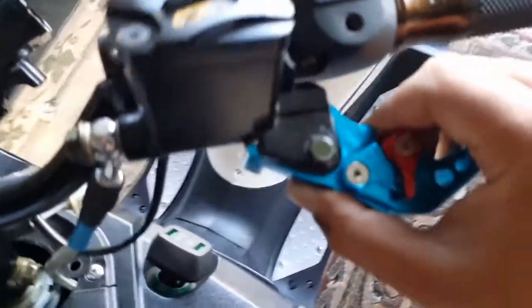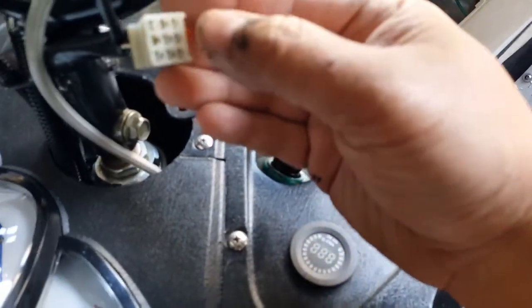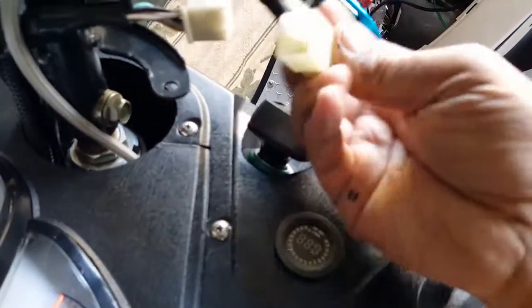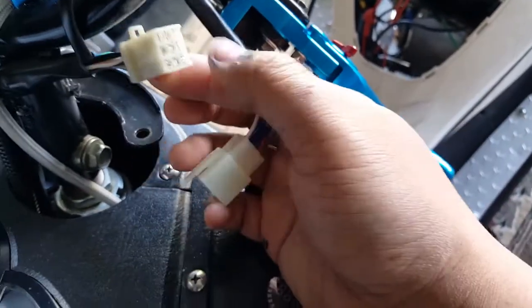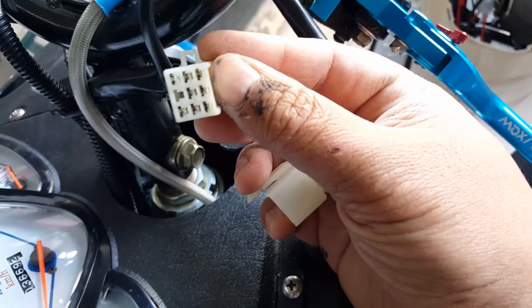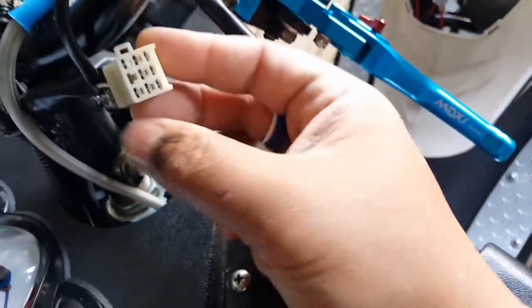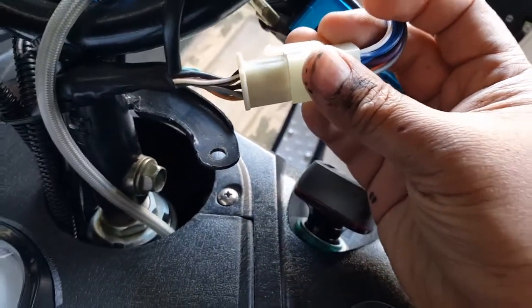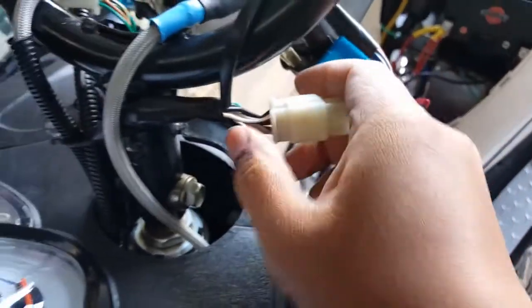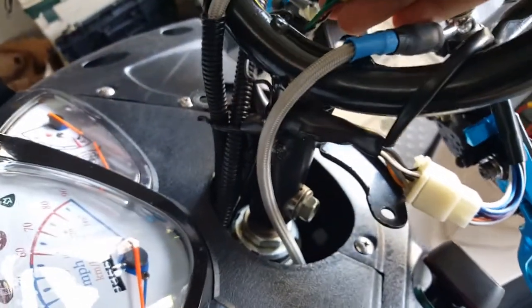They're all good — I'm really happy this is going to work out perfectly. You can see his wiring harness here — this is his old original — the same six-prong. This will plug into the same six-prong, with one that's missing right there. See that one missing — this one should also be missing. You can see it's more of a bigger, fatter T-shaped slot than all the rest because it doesn't have a lead in there. So this will plug in right here — let's do a little temporary plug to make sure. This guy is plug and play on this side with no problem. But unfortunately this side here has only four prongs — I'm not sure why, it's like they shorted a wire.